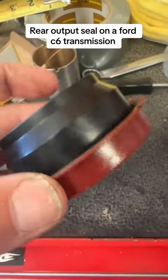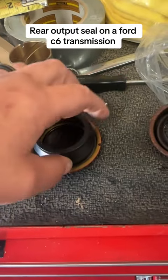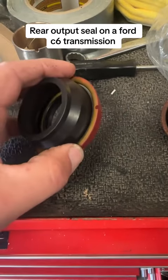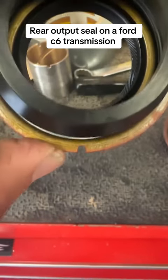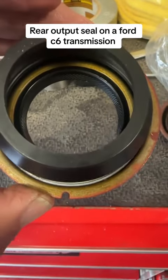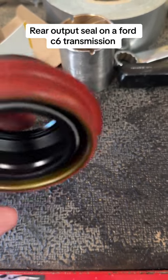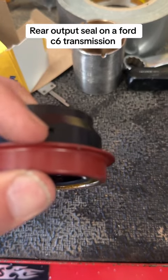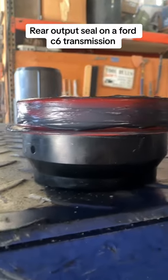Here's the new seal — spring is in there. The old one is missing its little cover too. I'll grease this up. I initially thought the little notch goes toward the bottom of the transmission, but correction — that notch doesn't mean anything. It's that little hole right there that has to be pointing down. Got the new seal all greased up and ready to go in.